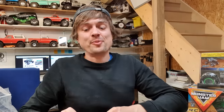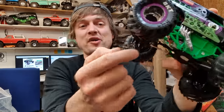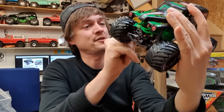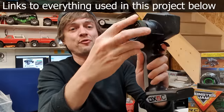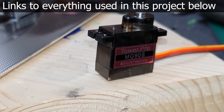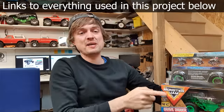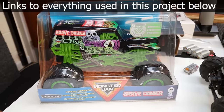There are a couple of other things I want to do differently. On this one here, the upper links are a bit of a funky angle, so it makes the axle behave a little bit weirdly as it moves up and down. So I'm probably going to put some shorter links on the next one and mount them somewhere else. I'll be using a spectrum receiver again because we've got front steer and rear steer on the toggle switch. For servos, I've got a couple of Tower Hobby Metal Gear servos. The body and chassis came off of this Spin Master monster truck, and the wheels and tyres come off of this other Spin Master truck here.